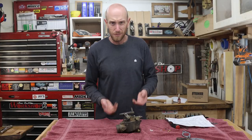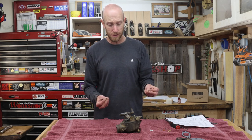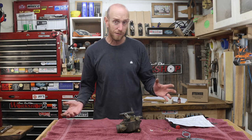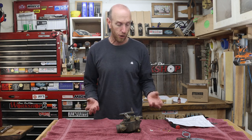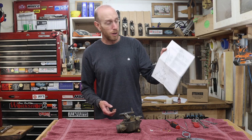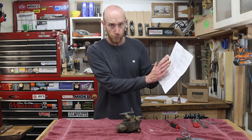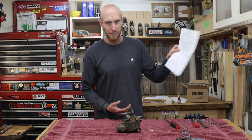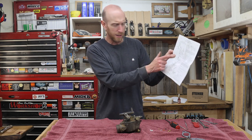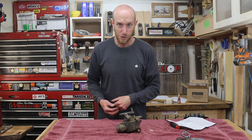So did you get all that? Really, it's not that hard. If you've never done this before, don't be afraid to try it. There's really not all that many pieces in there. It's just a matter of removing everything carefully, keeping track of your parts, cleaning everything up, making sure all the passages are open, and then replacing with new pieces where required. The rebuild kits do a great job — usually there's a very nice exploded diagram included. I always try to keep these even after I'm done, in case you forget which way something went. These diagrams are great.